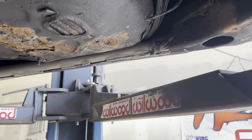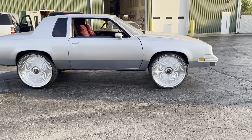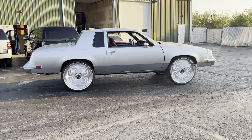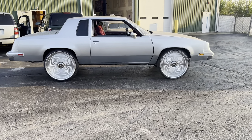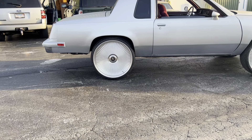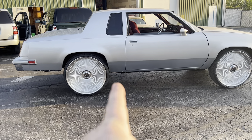The car's sitting good — again, stock suspension likes to follow the ground. There's no way of trimming all the bags — I don't do sway bars on the back but I do on the front. The links are all in there, everything's in. It's test drove. The shocks do not allow the rear end to travel farther than it needs to, so the tire will not touch. As for forward and backward, the lower torque box is not really on much of an angle.